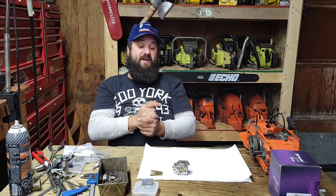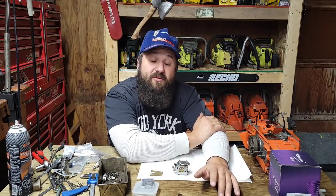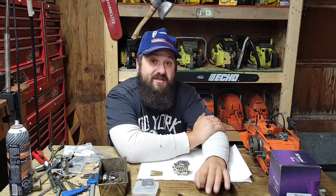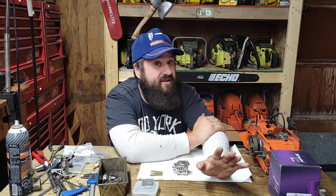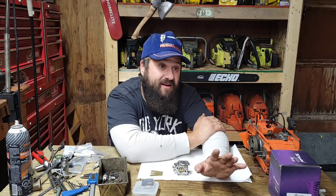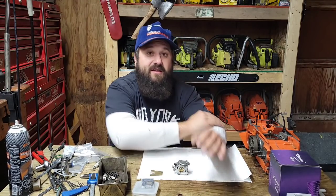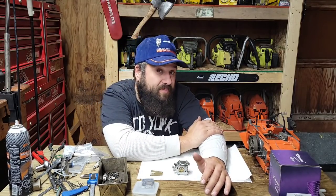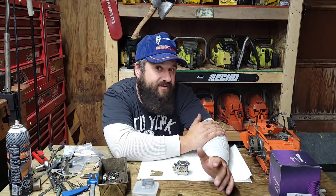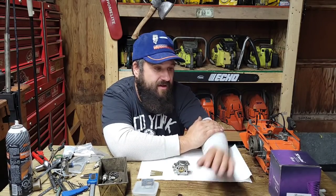I have used Farmertech. You guys ask me all the time. I don't really like Farmertech cylinders. I've had no trouble with them, friends. I built many MS-260s with Farmertech cylinders. They ran. They didn't go into a commercial cutting setting, though. They went to firewood guys that cut a cord a year, maybe. So I don't think those would last in the long term. And the port heights are just all over the place on those. But for the price, you can buy a Farmertech cylinder for, what, $25 to $30? If you got a cheap saw and you just want to play with porting, by all means.